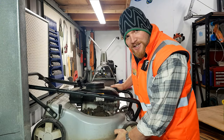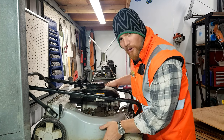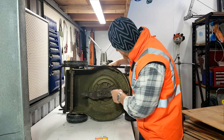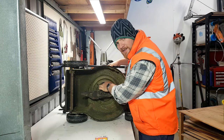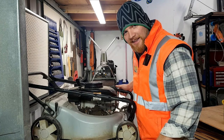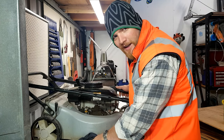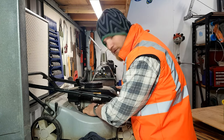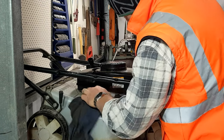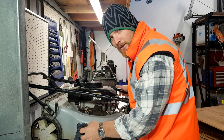There are two ways to get engine oil out of these old girls. You can do it from the oil dipstick up the top, or you can flip her on her side and do it from the sump plug. Just depends how you want to skin the cat. I reckon I'm going to make less of a mess going out through the dipstick, so let's do it. Just make sure you clean off any of the gunk on top of the filler cap - we don't want that to get into the engine oil and make a mess of the engine.